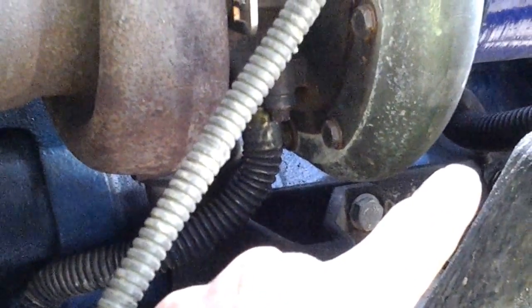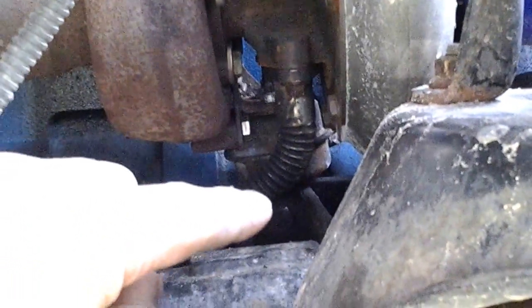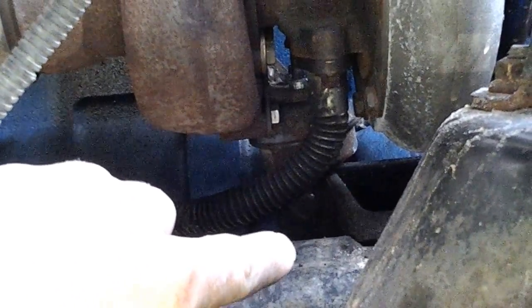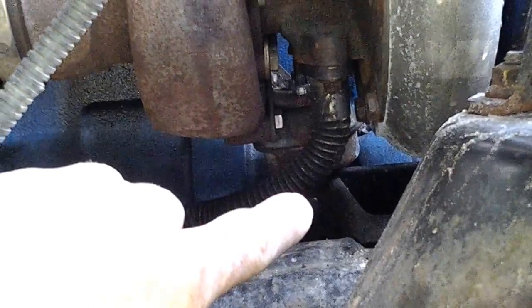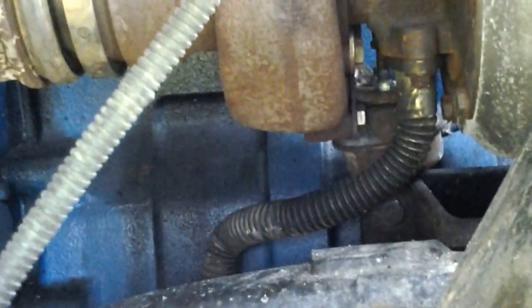So what happens on these common rail swaps, those first 2 hold the plate in. These 2 also hold the plate, but they start holding the motor mount. And then your back, which you can just barely see right there, that back is a captive nut that we welded into the plate and holds the back firm on that motor mount. Now, if you're using a Storm block, that won't be an issue because the motor mounts will be further back.